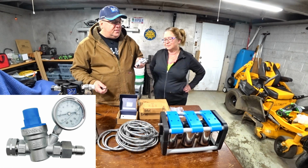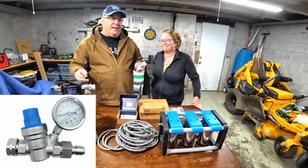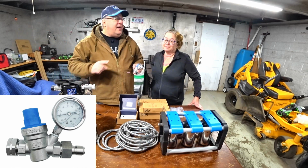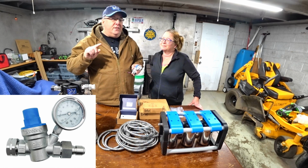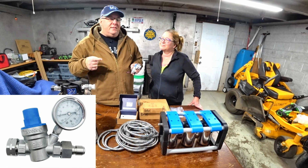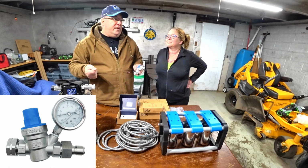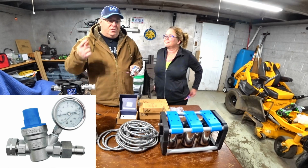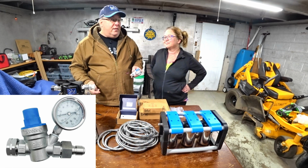The thing with these is, pressure-wise, you want to keep everything safe in your rig. You don't want to be blowing apart your faucet in your shower or your sink, or God forbid, any of the PEX lines that are running throughout your rig. Got to be concerned about that. I'll tell you what we did. We didn't adjust our pressure when we went camping at Dale Hollow Dam site, and our water pump could not handle the back pressure that it would normally hold to keep water from going into our freshwater tank. And because we didn't adjust the pressure, it filled our freshwater tank. We came back from somewhere, and luckily the freshwater tank was just leaking out the fill hose. It was just leaking on the ground. No big deal, nothing happened to the rig, but it could have been a lot worse, definitely.